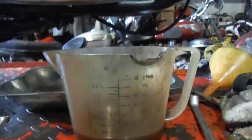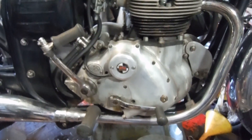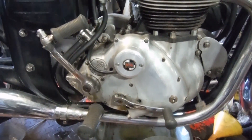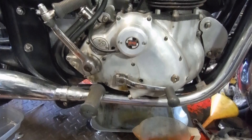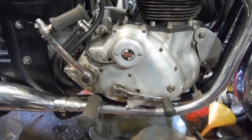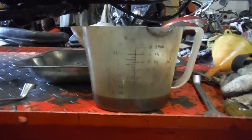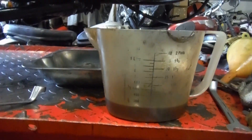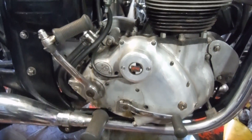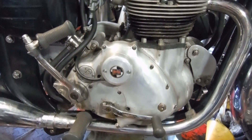The 300cc had either accumulated over the weekend, and obviously when the engine runs, even if you drain the crankcase, the oil pump will leave some behind. With that in mind, I ran the engine after putting the drain plug back in, ran it for about five minutes, got it warmed up, stopped it, and took the drain plug out again — and only caught 200cc of oil. So 200cc in the crankcase is probably about normal for running conditions; that's about how much oil you'd expect left in the crankcase when the engine's running, scavenging and whatever.